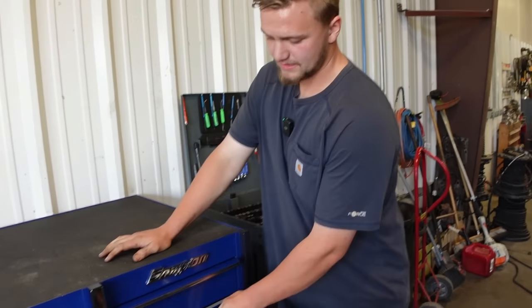More room to grow and buy stuff. This is my welding helmet in there, raincoat, gloves. Do you do much welding here? Yeah — we'll do frames, make a truck longer. We'll cut the frame and put more frame rails in, or change the whole clip. Sometimes if you want an extra axle, that little pusher tire, and you can't fit one right there you have to make the truck longer. Or if the frame's cracked and the suspension's worn out, it can be cheaper to just cut it off and weld a new better one on.